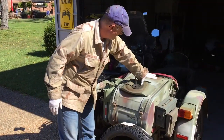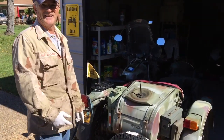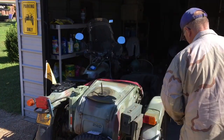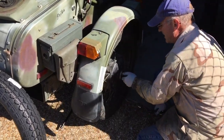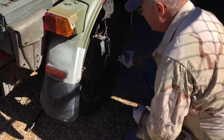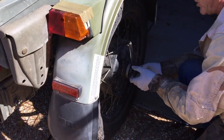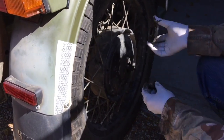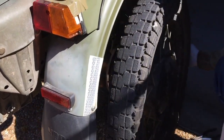After multiple times forgetting, I do remove the plastic rim on the spare tire, because you will not get it on or off with it attached. Now we're going to take out the cotter pin — or R-pin — which is reusable. The castle nut: some people tighten these within an inch of their lives, but I just tighten it hand-tight, try to align it with the hole, then unscrew it. I've never had an issue. On both my pusher and sidecar I just do hand-tight — I see no advantage to tightening more.